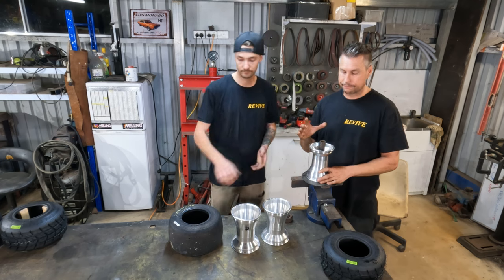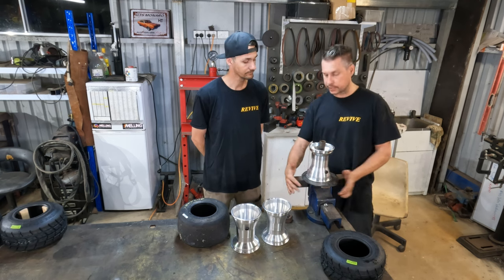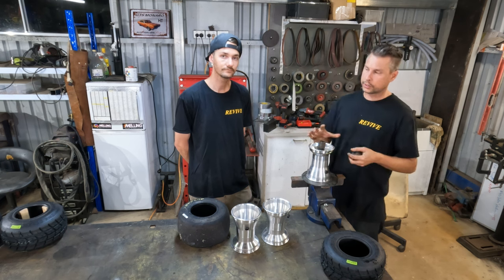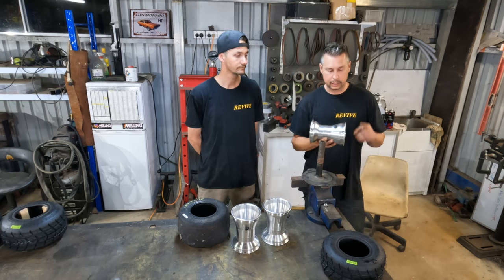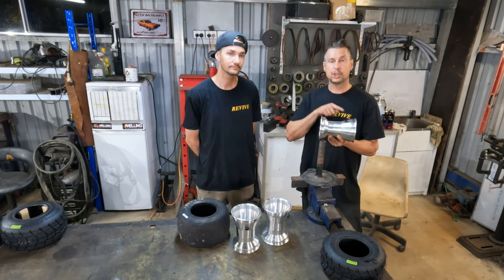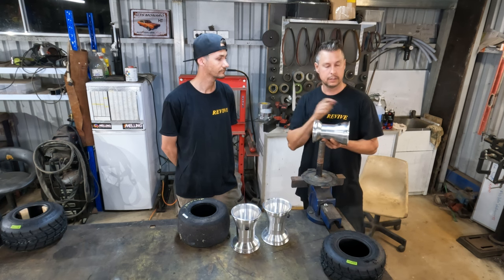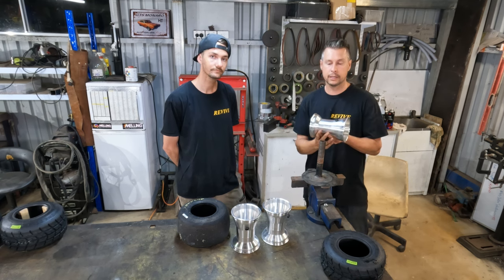Generally, because we are fitting quite a few tires onto quite a few wheels, we basically made this little jig that sits in the vise, and we're gonna lock our wheel to this just so it doesn't move around. It's worth pointing out, if you've never changed tires, if you look at one of the go-kart wheels or any car wheel, for instance, we're gonna have a sharp sloped side and we're gonna have this kind of mellow sloped side. The tire is always going to go on from this sharp side, not this mellow side. So when I put it into our jig, I'm going to have this sharp side facing up.